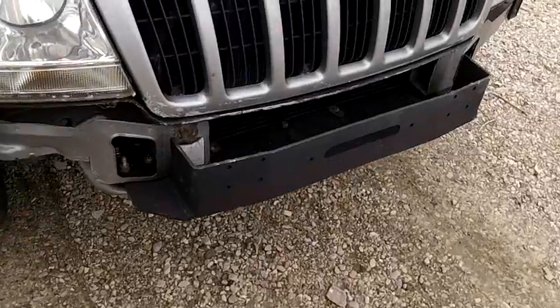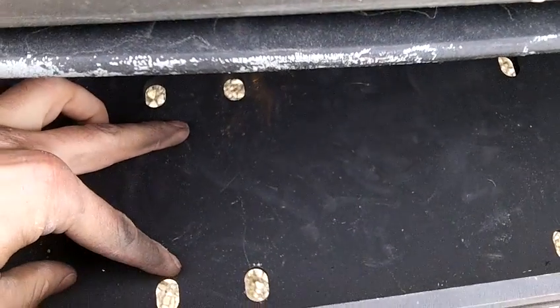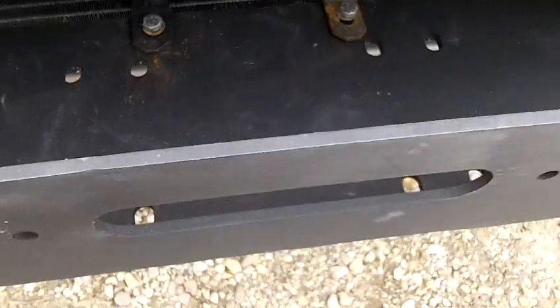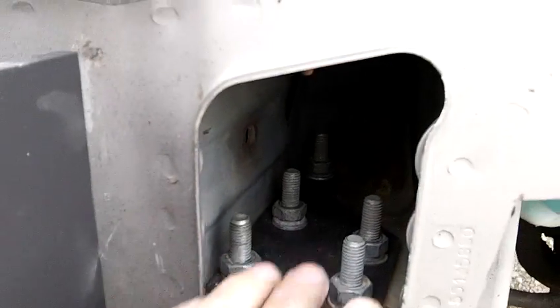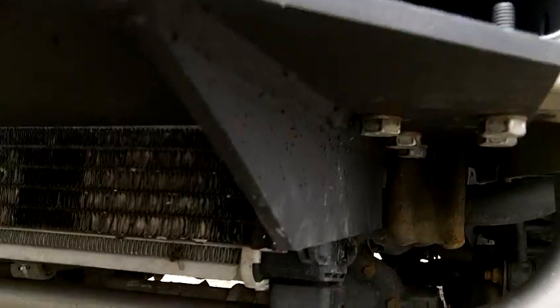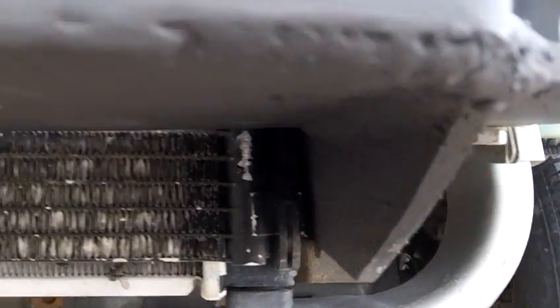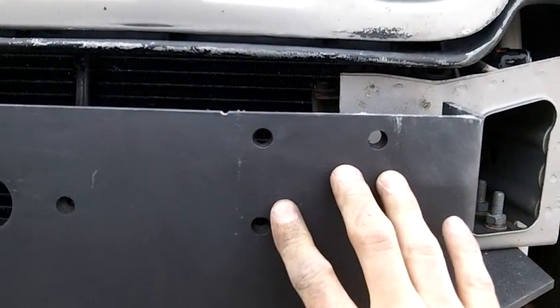I finished it today, painted it, and installed it. As you can see, it's got what I think are the two most common winch mount bolt patterns, so I had them put in both because I'm planning on selling these. There's where the hood mount supports go, and there's an extra hole if you've got a transmission cooler. It mounts with five bolts on each side through a mother washer. It comes down here and goes clear back past the radiator with all the clearance so it doesn't touch anything.